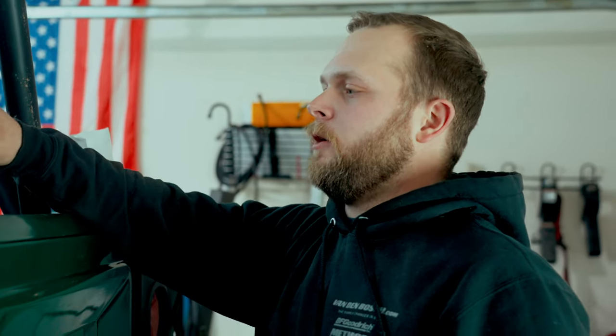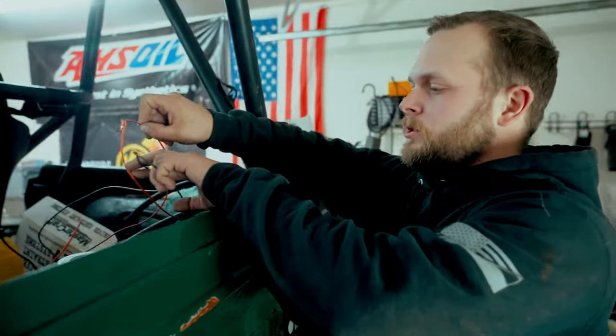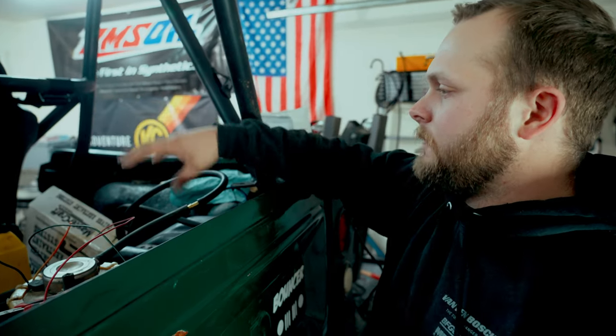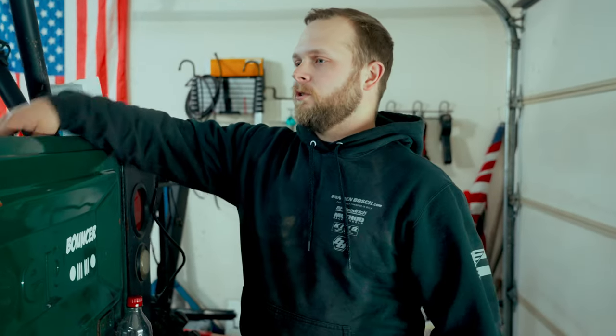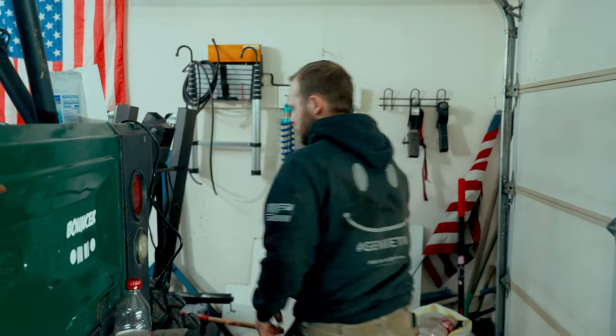I've got the fuel pump in. I've got it wired up for what I think it's gonna be. All I did is I twisted these wires together. I didn't legitimately do crimps or anything, because the idea is I just wanna make sure that we've got fuel pressure, make sure it's all operating. And then we have a motor-built fuel cell that we're gonna be mounting in this. So all of this is coming right back out and be dumped inside of our fuel cell, and the fuel cell's gonna be mounted. So we're getting rid of the stock tank back here. So I'm gonna go flip the switch real fast and see if we got fuel pressure.